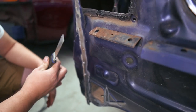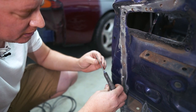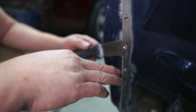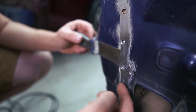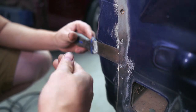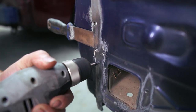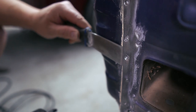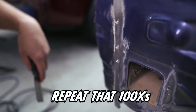The other tool you're going to need is one of these — I think it's for drywall or something. You need to make sure it's not too thick but also not too thin. You need to be able to hit it if necessary to cut between the little slivers left in case the drill bit doesn't get through the entire spot weld. You can also just put it in to create some tension, so that when it does cut through, the other panel pops off — that's a clear signal you're done cutting through the first layer and you don't keep going into the second. So you can see there it's through the first layer — now just repeat that like a hundred more times.